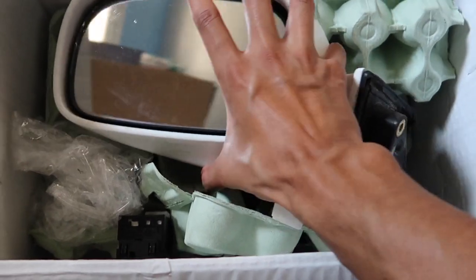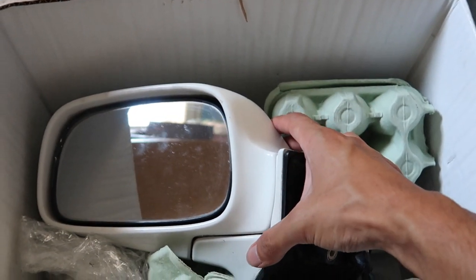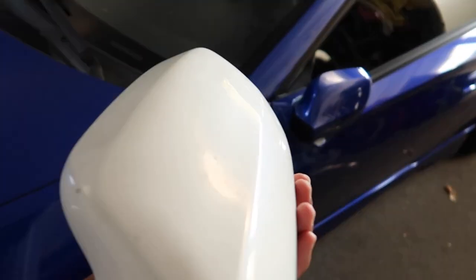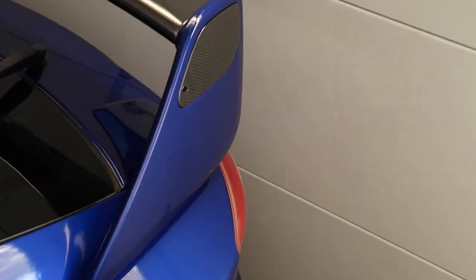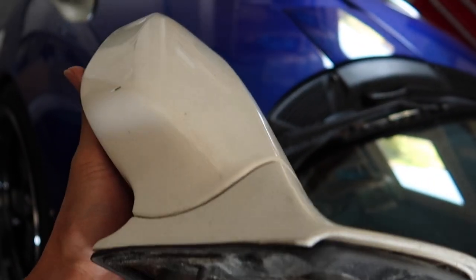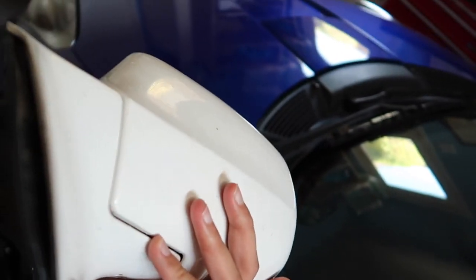But I feel like that's too much work and honestly I don't think it's too big of a deal. I'm just going to directly bolt them on and splice them. I think I am going to paint these black instead of wrapping them blue, because when I was wrapping the mirrors — these wing stands — it was the biggest pain. So what I plan on doing is sand this whole thing down with maybe 400 or 500 grit, primer it, paint it black, clear coat it, and just get ready to bolt it on.